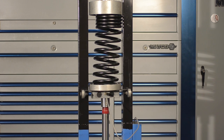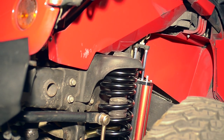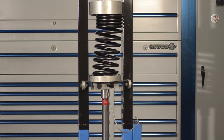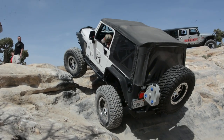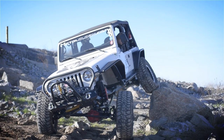Metal Cloak asked noted spring expert Mike Thiebert from Betts Spring Manufacturing what the major benefits of the True Dual Rate Coils are. When you lift the vehicle up, it maintains pressure on the retainers and the spring does not move. When you put the vehicle on the ground, that first section closes completely and then you have one single rate left over. The True Dual Rate Coils give you the additional lift you need for bigger tires, more ground clearance, and greater articulation, and now there's enough free length to provide downward force at the extremes of articulation.